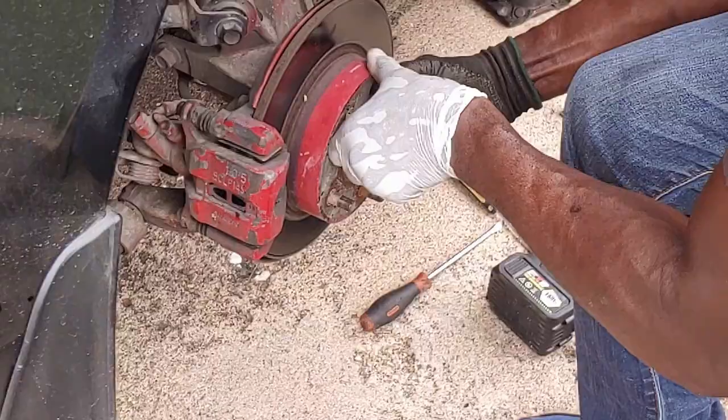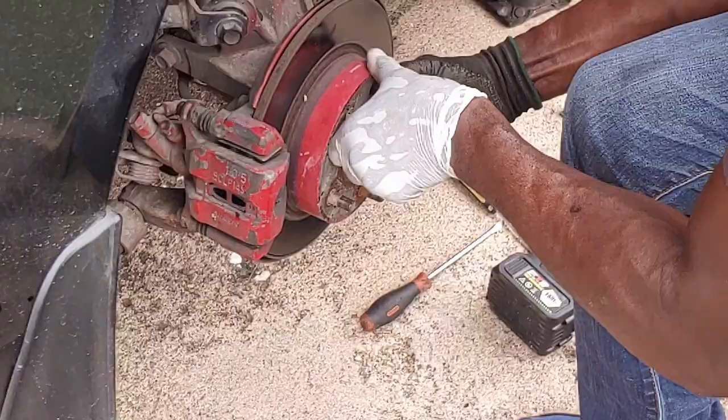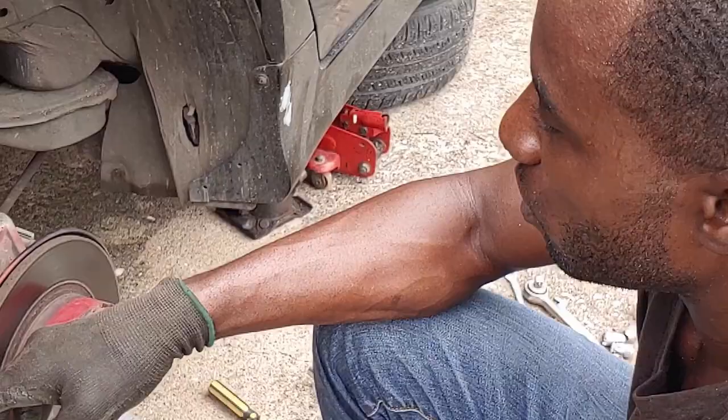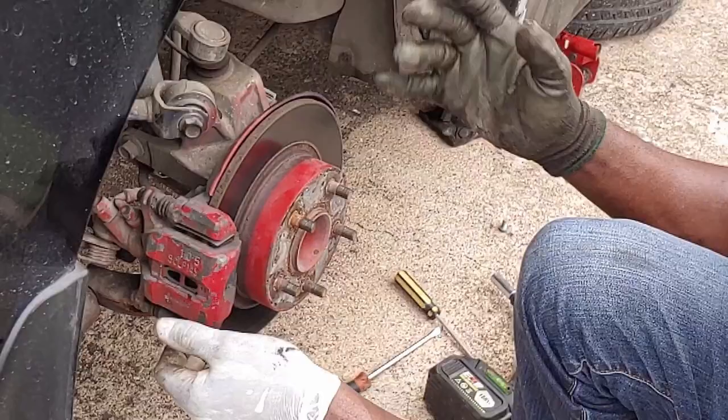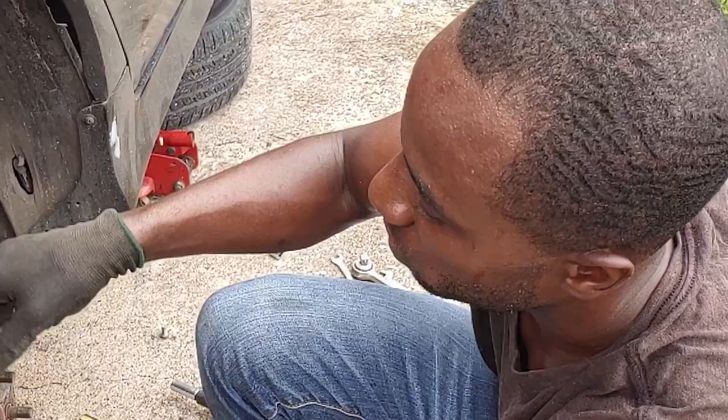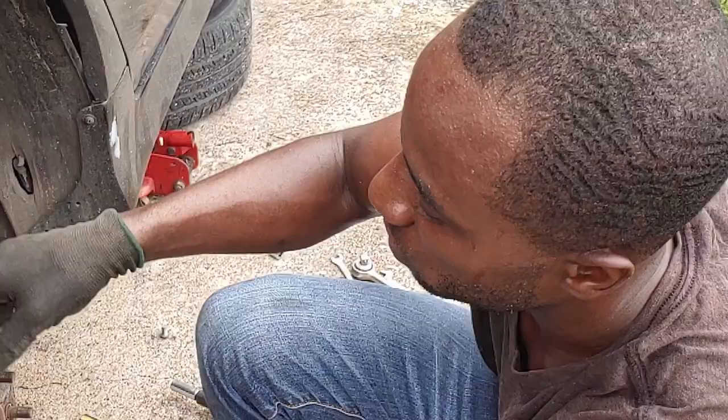Before, what I should have done is show you why the brake or the e-brake needs to adjust. Because you would have noticed that this wouldn't have that slight tension on it — it would just be rotating, like a bicycle wheel, no tension at all. What you need is just enough — just a little grabbing, just a little brushing — so it's not turning freely.